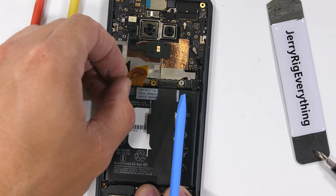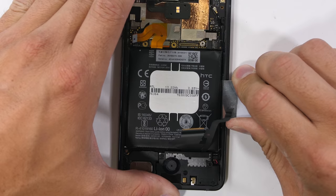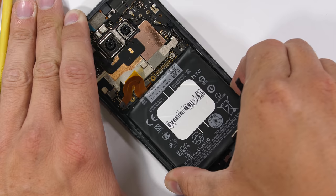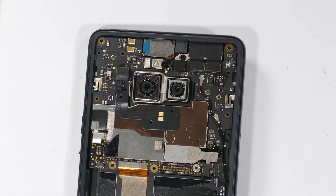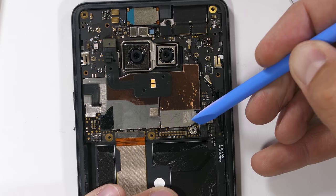The next thing is to remove the decently sized 3500 milliamp hour battery. Unclipping the Lego-like battery connector from the motherboard along with both of the charging port extension ribbons. Thankfully the whole battery can pull out and away from the phone body — not a whole lot of effort is needed. No pull tabs, which is totally fine as long as that adhesive doesn't have a death grip. Another removable component is the SIM card tray, which conveniently has an expandable memory SD card slot — bonus points for that.